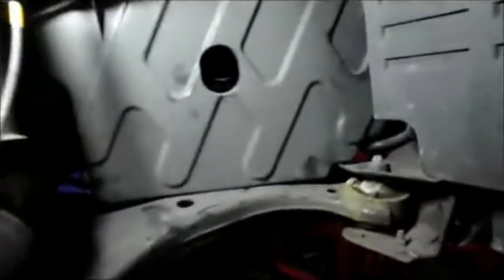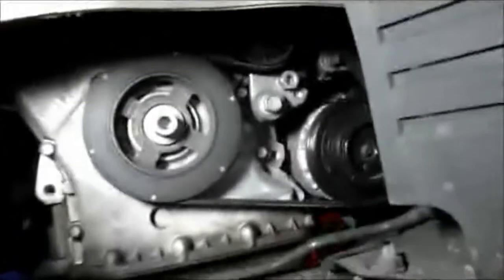The wheel is off and this is the cover. I started taking out the bolts already — there are actually four 10 millimeter bolts up inside here, including one that's all the way up in the front. To remove this cover, you just take it and slide it to the back and pull it right out. That gives you some access to the tensioner.